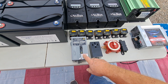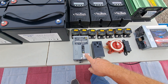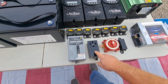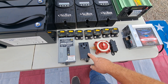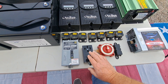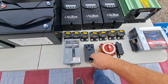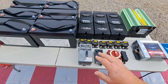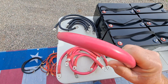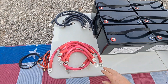At this point we're talking AC and not DC. So to this circuit breaker I ran a wire from here to our bay where our shore power cable is located, and then I installed this outlet. Instead of buying a transfer switch, I figured you've got to go outside to plug into a pedestal anyway — that was my transfer switch right there at my hand. I would just simply plug my shore power cable into this and then the system powered my motorhome. To connect the batteries I have the four-aught cable, which is pretty heavy-duty stuff — with four-aught you don't have to worry about drawing too much current for the cable.